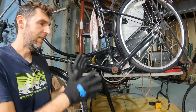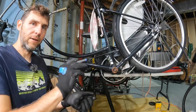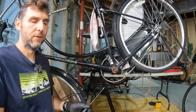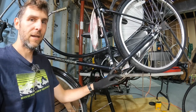The left crank arm was actually way harder to get off than the right. The threads were kind of messed up — I eventually just used a pick to kind of clean out the threads, and that seemed to work. I was able to pull it off. We'll see later if I damaged those threads, but getting this off is the most important part.